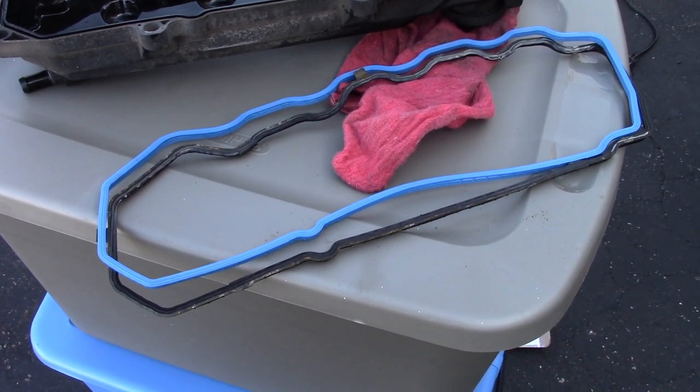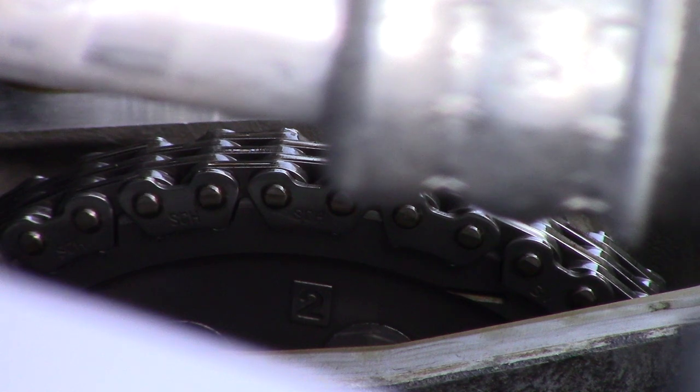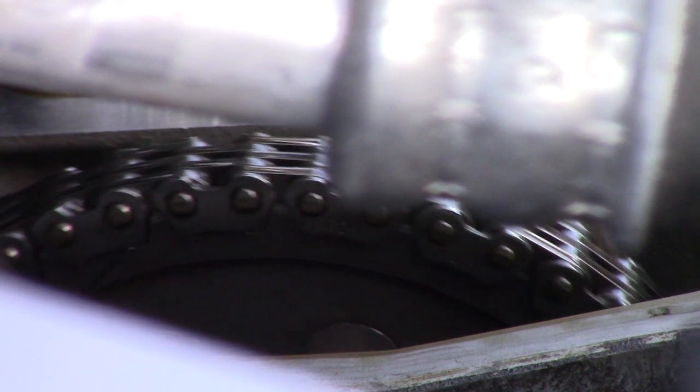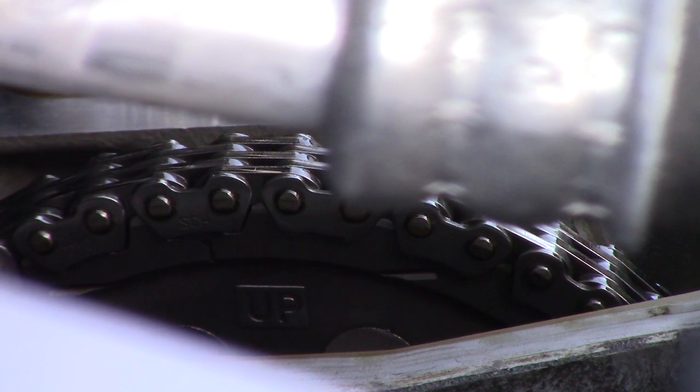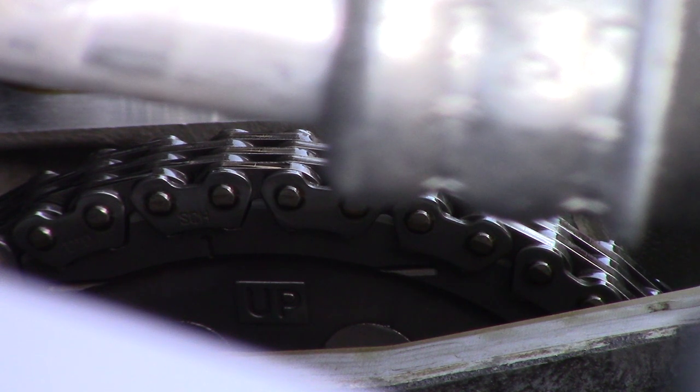Before going any further I wanted to make sure that the replacement gasket — the blue one — was the same as the black one, and it is. Next, go to that crank port at the side of the car and stick in a 19 millimeter deep well socket. You can add as many extensions as you want so long as you can turn the engine. Gradually and carefully rotate the engine clockwise until you see the marking that says 'up' and look for the hash mark at about the two o'clock position on the camshaft sprocket — that should be even with the cylinder head, showing cylinder one at top dead center. Repeat that for all four cylinders: two, three, and four are marked with a square, while 'up' designates cylinder number one.